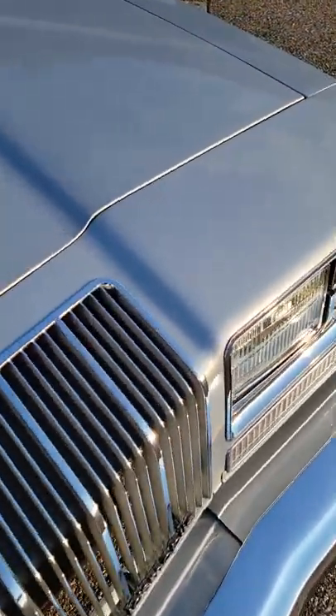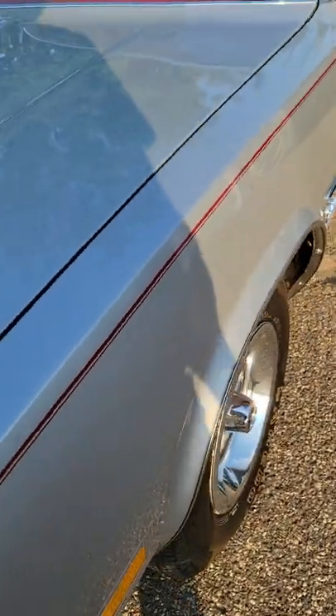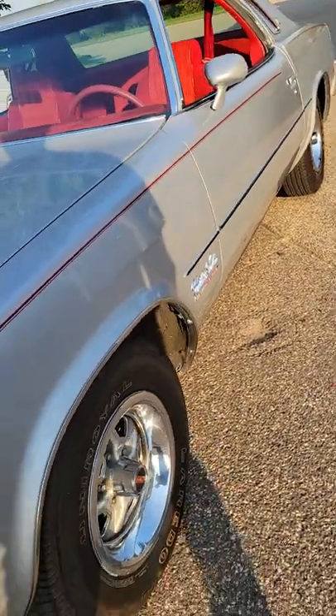We'll go over by the hood here — two mils on the hood, and it's always probably thin. Other side of the hood: two mils. Other side of the car, driver's side front fender.